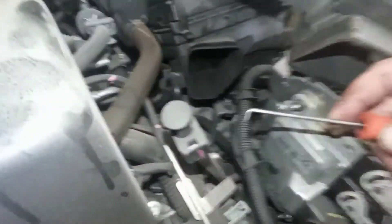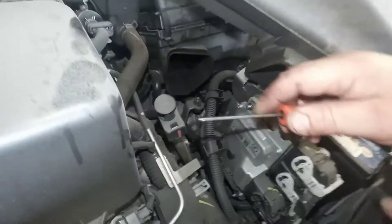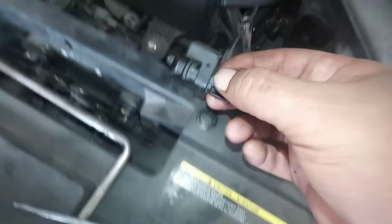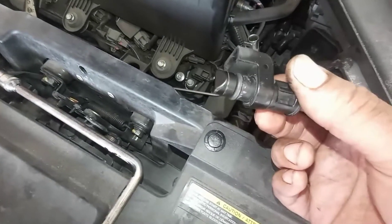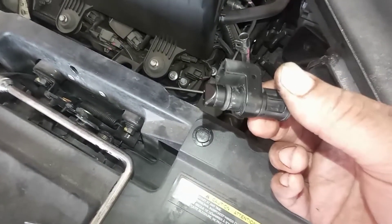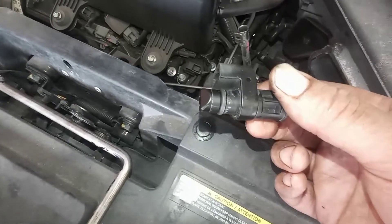The second thing we're going to do is open the dipstick. This is a sealed transmission, so I'll open the dipstick and try to open it now. You get this plug — all you see is a sealed transmission, so you cannot check the fluid. You have to drain and refill the fluid, matching how much you take out.